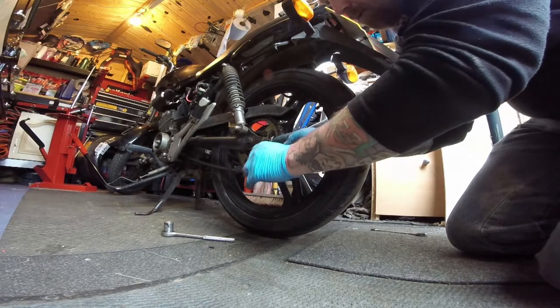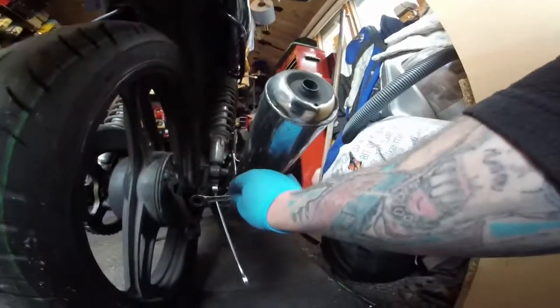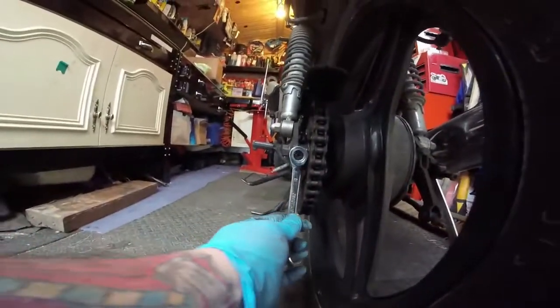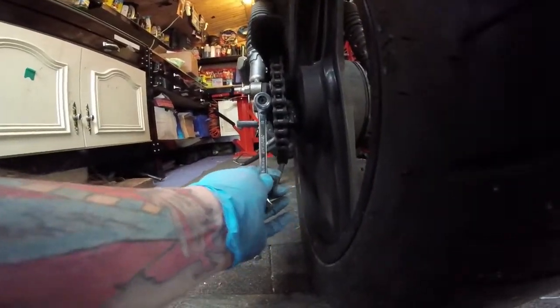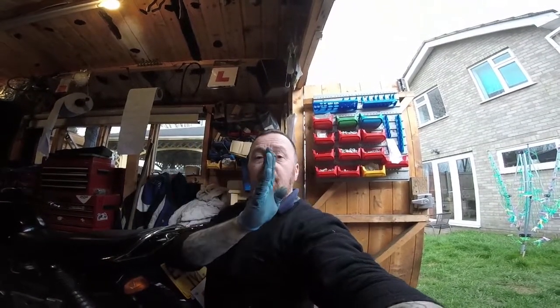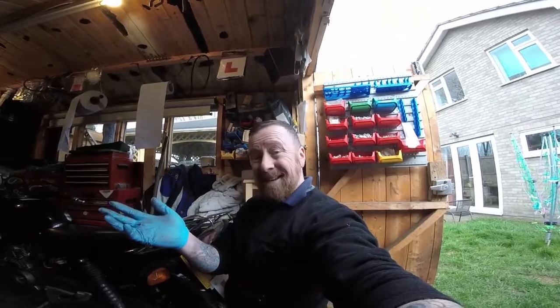Going in, we'll just go one and test — the chain needs more. Quarter turn here and a quarter turn there. The reason why you do equal turns is that if you put five turns one side and fewer the other, your wheel isn't straight and it'll wear, feel funny, and won't ride nice. It needs to be done properly and that is it.